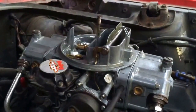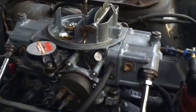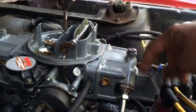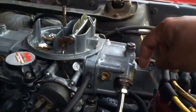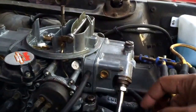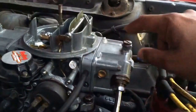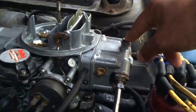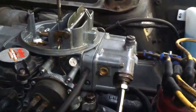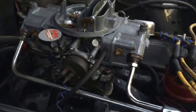One more thing before I go — this Holley carburetor has a little sight glass. You adjust a bolt up and down; there's a needle valve like your toilet tank adjuster, and you want to keep the fuel level right at the bottom of the sight glass. When it fills up like a toilet it stops right there, drops, fills again. With the car running, turn the screw clockwise or counterclockwise to adjust fuel level until it just dribbles out of that little hole in the plug. Hope you enjoyed this video and learned something — if you have any more questions, let me know. Thanks!